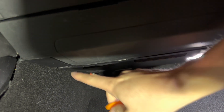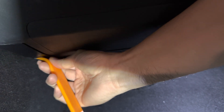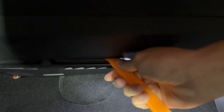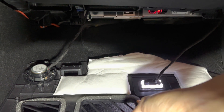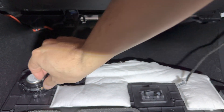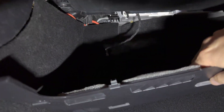There's one on the left right there. So once you have it all unclipped, go ahead and use the other side of your pry tool. Get some leverage and pull this down. Don't worry — this is not where your airbag is. This is just nice soft foam insulation. Pull out this footwell ambient lighting, and you have a speaker here you can disconnect as well. Just pull it right out so you can remove this cover.